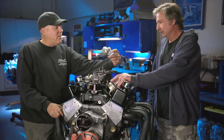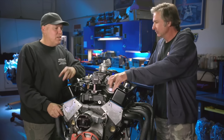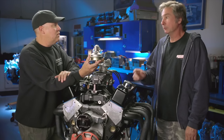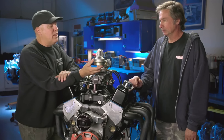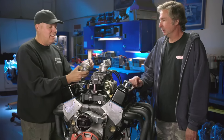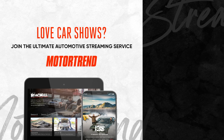I would run the budget pump on 400 horsepower all day and not worry about it. If you're on a super tight budget and not making super high horsepower, it's not too bad. But when you crest north of 450 horsepower is when you've got to really start paying attention. As much as the Carter super pump was my go-to on everything in the 80s with nitrous, I now actually believe there is merit in overkilling your fuel system and getting that 170 gallon-per-hour unit on your 500 horsepower motor.